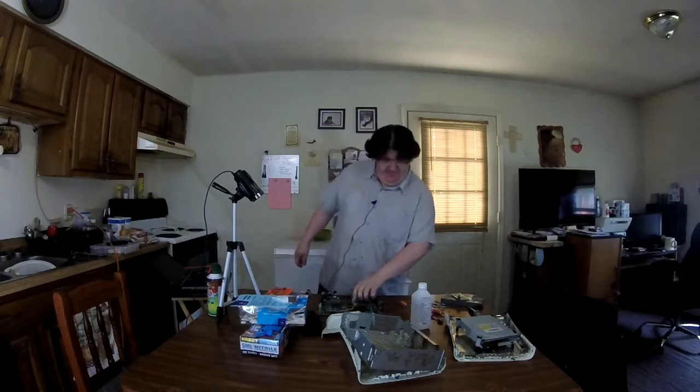I will now explain to you the reason for the X-clamps on the 360. From what I have understood from research and from what I've seen of actual computer processor backplates, these X-clamps are here for a reason. Do not use the so-called X-clamp mod. These are here to help with flexing on the board. These processors get so hot that they can cause flexing in the system. The flexing can cause cracking. But because these are here, they stop it from warping in any way or shape or form.